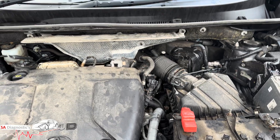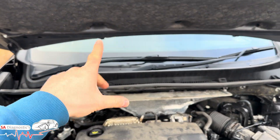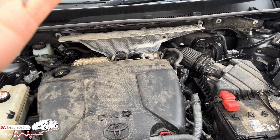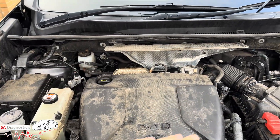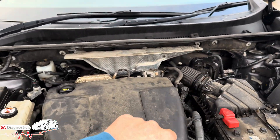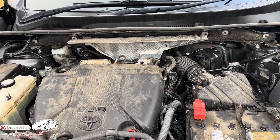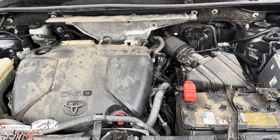It's plug and play really. After you've done that, I would recommend doing a diagnostic scan — do a full scan, clear codes, go into the engine control module, go into the adaptions, and reset the O2 sensors. There are different sensors as well that I'd recommend you reset, so everything is back to manufacturer settings.